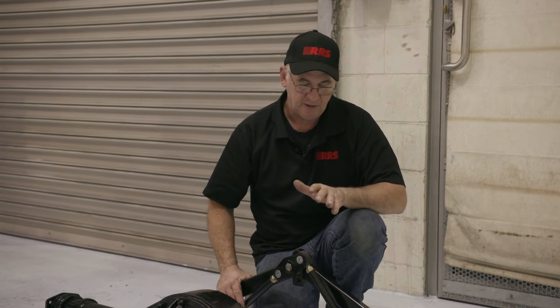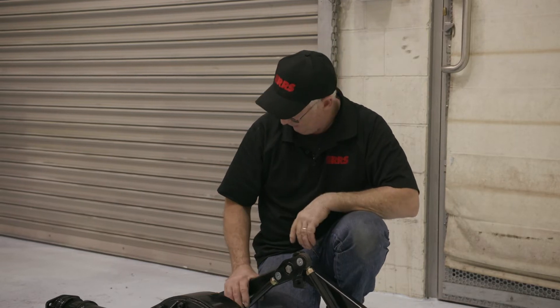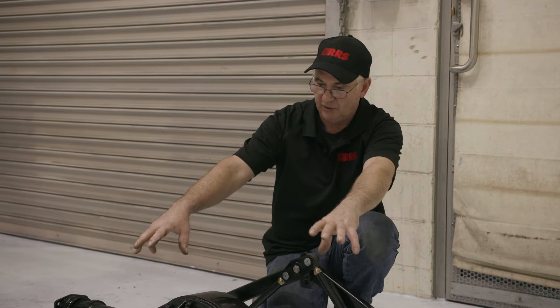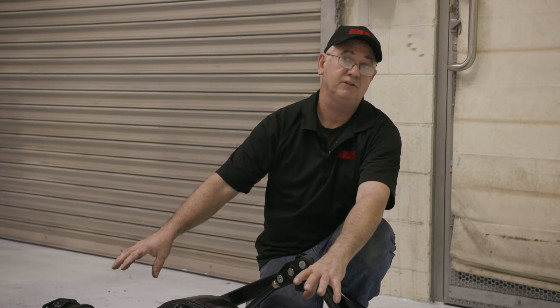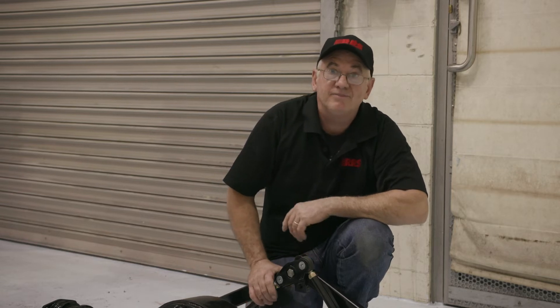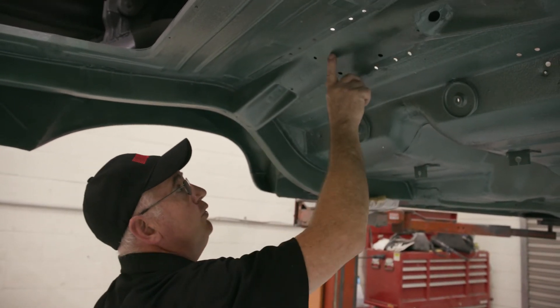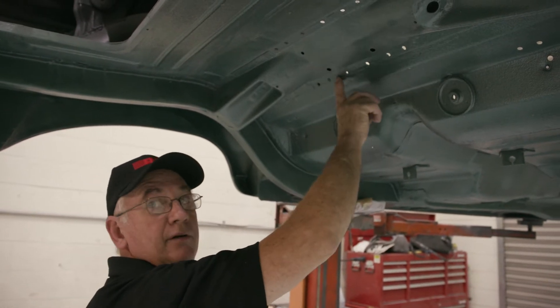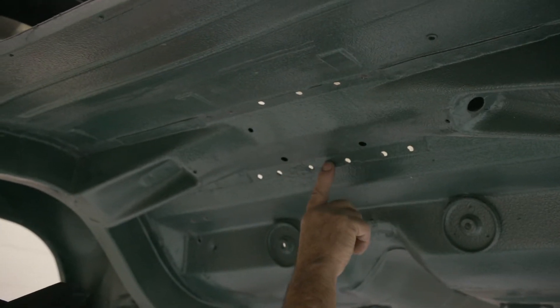That way we can get a nice balanced car in its cornering capacity — no excessive understeer, no excessive oversteer, nice and neutral. That's the way I like it. Added to that, we also have our height adjustments. Because of this particular application, we've gone very, very low because of the massive big rear wheels, otherwise it would look like a four-wheel drive, and we don't want that. So let's bolt it all in. Prior to fitting this rear shock absorber mount, we removed the factory snubber — there's a steel bracket that's normally welded to the floor on US Falcon Sprints and Australian early Falcons. That has to have the spot welds drilled off, making sure it's nice and flat so that this bolts up in place.